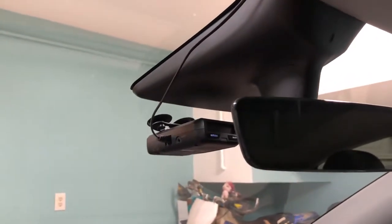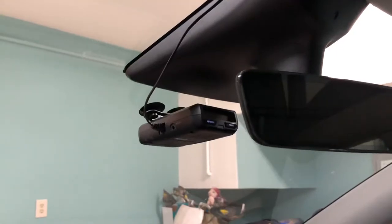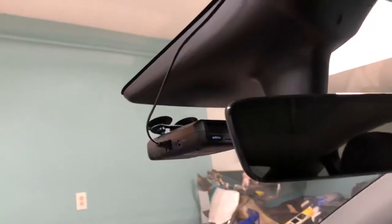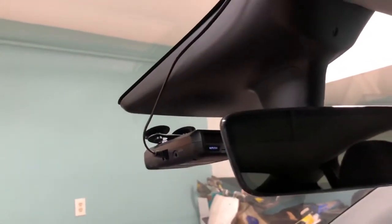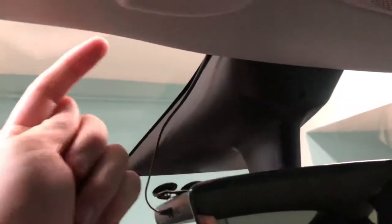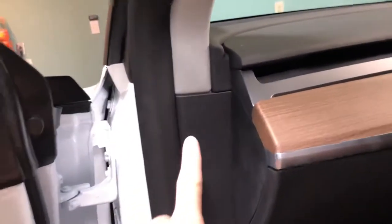To hardwire the radar detector, running the cable through here impedes the cameras and you can see the cable from the outside of the vehicle. So I ran the cable up just to the headliner — I was able to slide the cable into the headliner here using a pry tool to provide a little extra space and push the cable in. The cable then runs down the top side of the A-pillar and down through this channel, with the trailer tow connector right behind here.